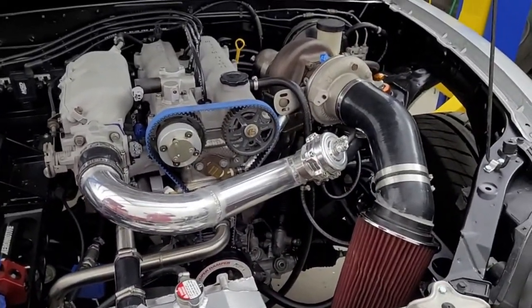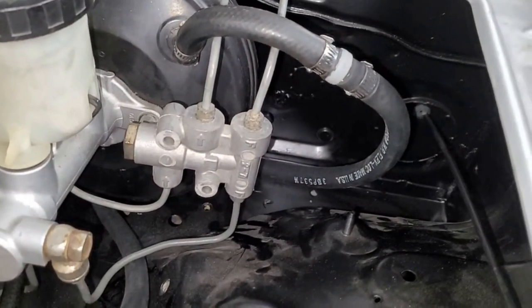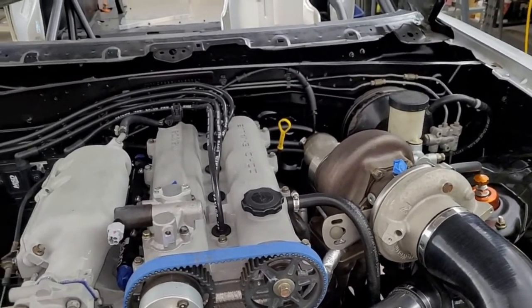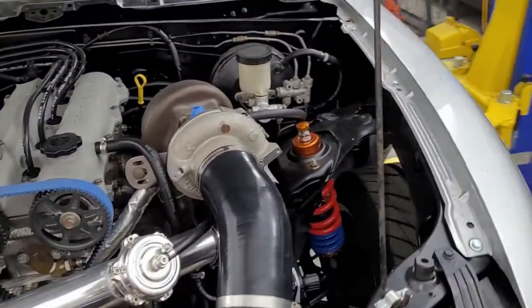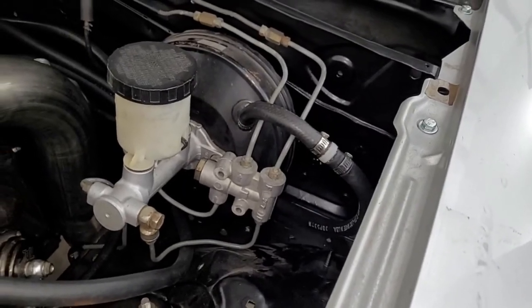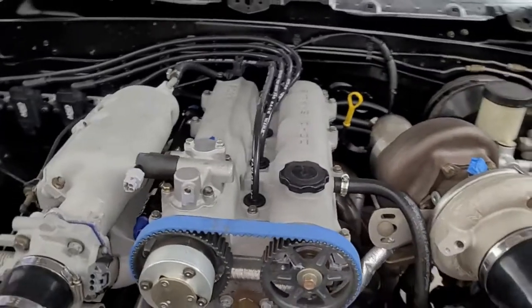We might have done a couple other things. I don't remember. I guess we ran the brake booster hose. I have a custom one. I mean, custom is just a piece of hose with a check valve. But I already put it away. But I actually purchased the metal pipe and the factory hose that goes here. I was going to install it, and I was looking at it, and it's kind of in the way. And then I thought about it, and I was like, well, okay, how about this? Whichever one's lighter. Well, the custom one is lighter. The factory one with the two hoses was like 0.82. This one was 0.6. And this one even had the clamps. So it was lighter to do that one, so we ran it. Plus we already had it made, so it was easy to install.